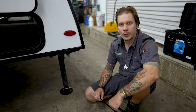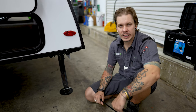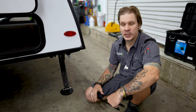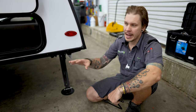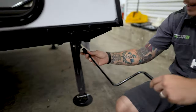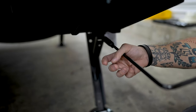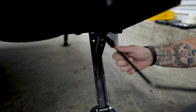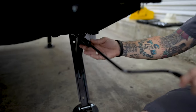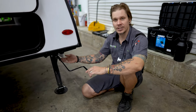Here at the rear corner we're going to find two stabilizer jacks on both the driver and passenger side of the unit. These are for stabilizing the unit — they are not for leveling. The idea is that this is just going to make things feel more secure when you're inside walking around, so you're not bouncing off the tires. When we go ahead and operate this, we use the included crank handle here — it is a spline drive system, so we just go ahead and seat that fully. We're going to come down, make contact with the pavement, maybe just a quarter turn more to shore things up. We don't want to overstress these, as they will operate better and longer if we get in the habit of using a light touch.